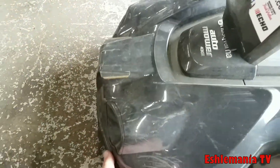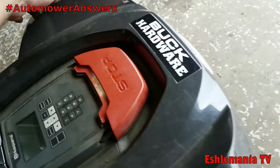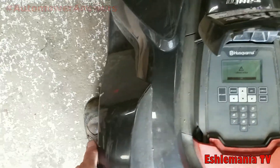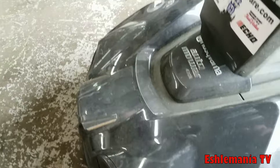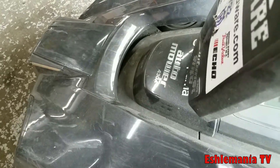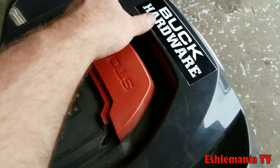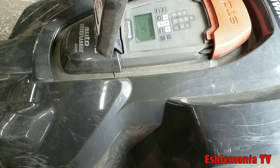The first thing you want to do is grab all four corners of the body and make sure that all four of those are secured to the joysticks underneath. If a back corner isn't secured, you're going to have an extra bit of flop there — the back will feel as loose as the front feels. In the front they do move a little bit because those are your lift sensors. Just go around and push down on all four corners where the joysticks are. If you hear a snap sound, it means the body was lifted up off of the joystick sensors. Just snap it back on and see if that solves your problem. If not, move on to the next step.